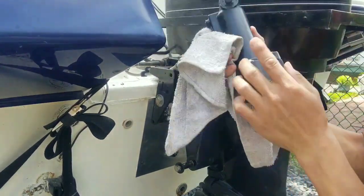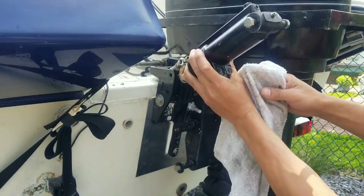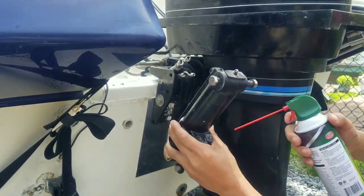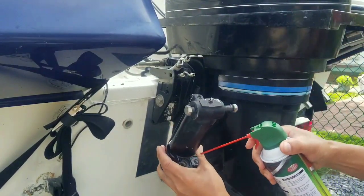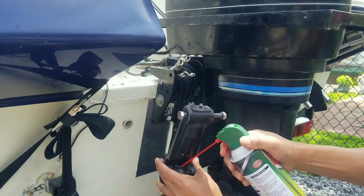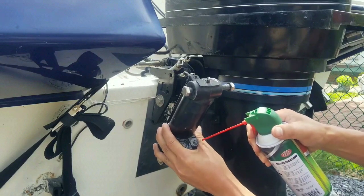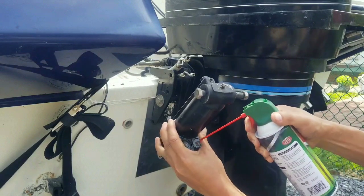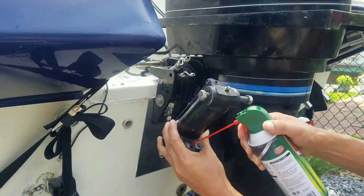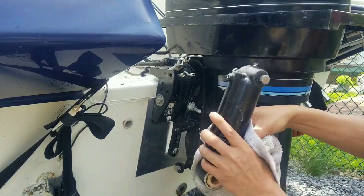Make sure you can see this. You're going to want to install them right there. Before you do it, you're going to want to hit it with some compressed air and actually clean them out. Watch your face. You want to make sure there's no particles in the sockets at all. Don't break the seal — you'll have oil leaking everywhere. It could be conducive of a bad day.